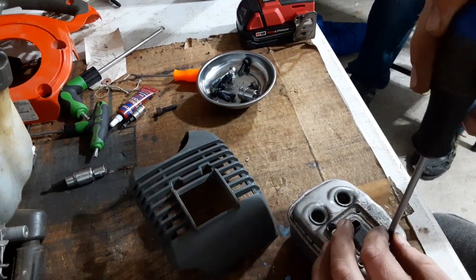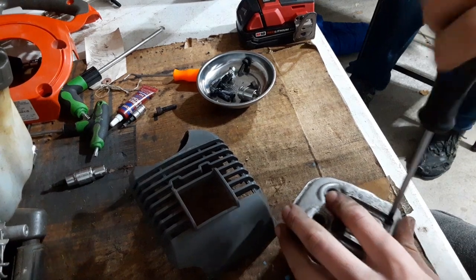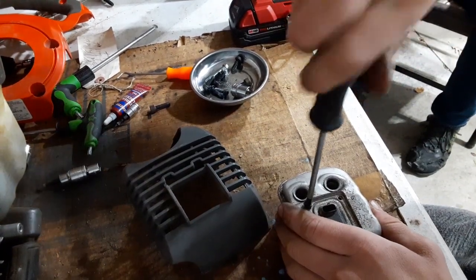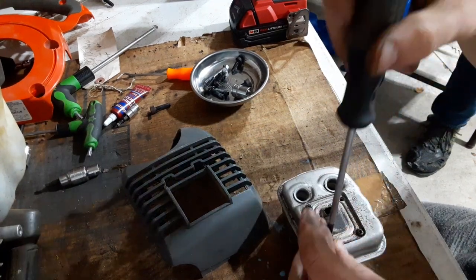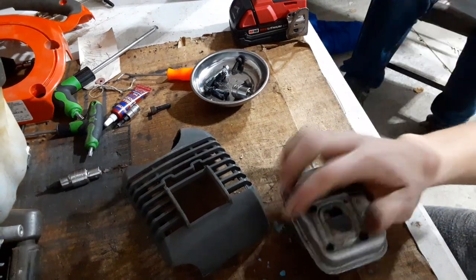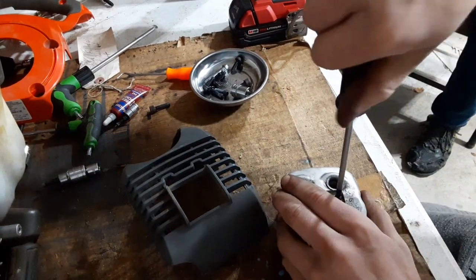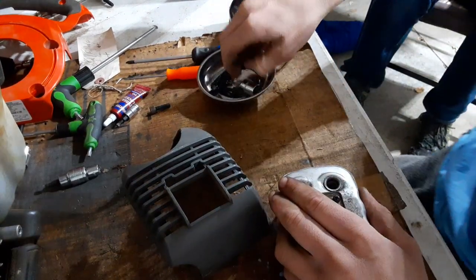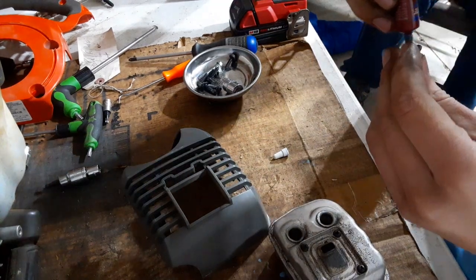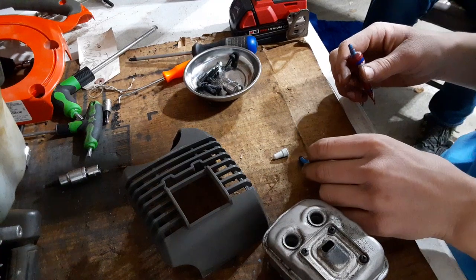What they do with mufflers is make it hard for the exhaust to get out, which limits your machine a little bit. If you took the muffler off it would be easier for your machine to run, because your machine is not only powering the blower but also pushing out the exhaust it creates. You're losing power because the exhaust pushes through all those passageways in the muffler. So really it's the EPA's fault — and another reason is they run your engines lean because of those screws on the carburetor, but don't get me started on those.